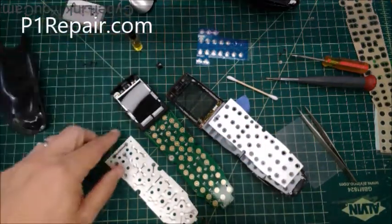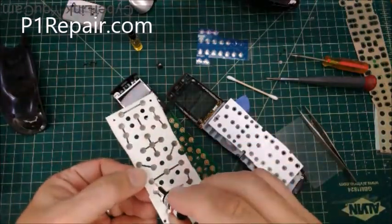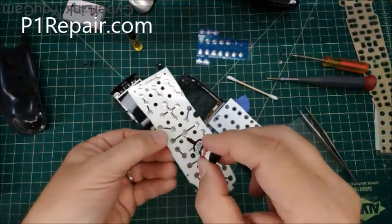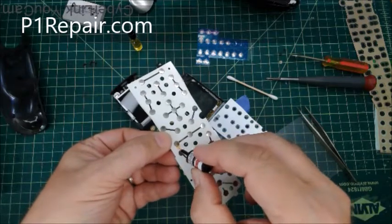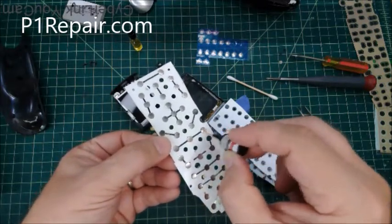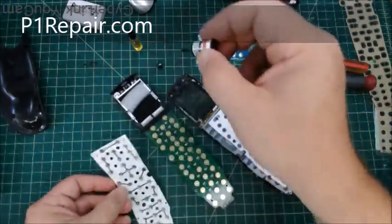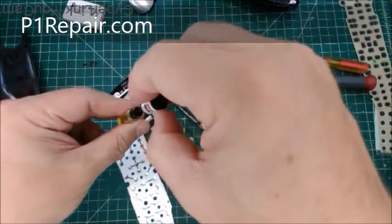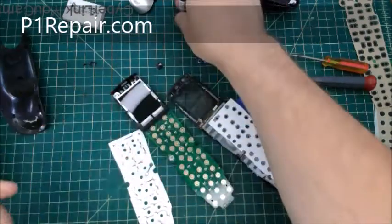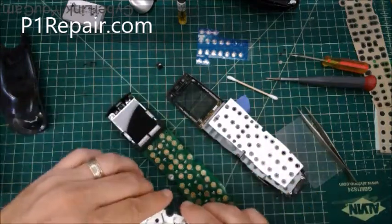And even more important, if any buttons are acting up for you, I would just get a little Deoxit on there. Just try to get it smoothly over the whole thing. It's a very, very thin, light coating. You don't want it really built up in there. It wouldn't really hurt it, but there's no sense in having liquid in there for a long period of time.